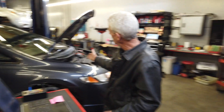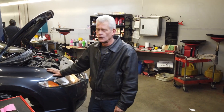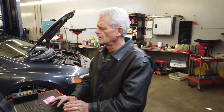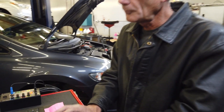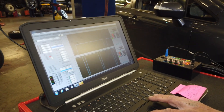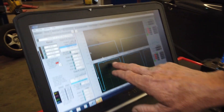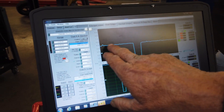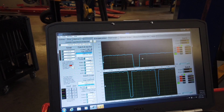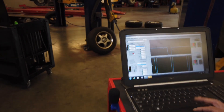We've been warming this car up for quite a few minutes getting it ready to do some lab scoping. Here on the lab scope we're running the live waveform on the crankshaft sensor. If we trigger the scope and stabilize the waveform you can see that we're getting voltage control problems at the top of the crank signal, and every so often this crank signal will drop out and lose about a volt to a volt and a half of amplitude.